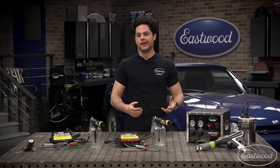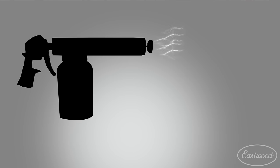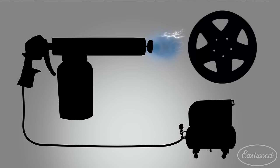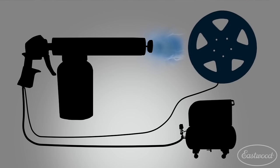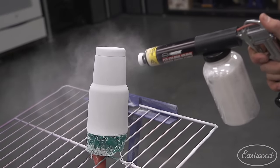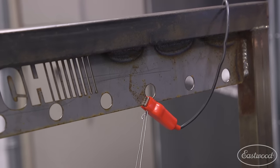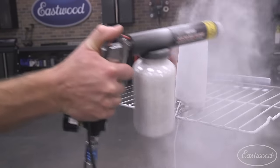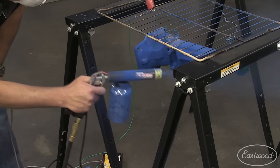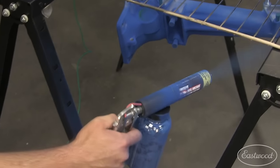So what's actually happening? When you activate the powder coating gun, the emitter ionizes a small patch of air in front of the gun. When you pull the trigger, compressed air flows through the gun, picks up small particles of powder, and blows them out the front. As the particles pass through the ionized cloud — about the size of a golf ball — they pick up a negative charge of up to 25,000 volts negative in our dual voltage system. This is called corona charging. Those ionized particles search for an earth ground or neutral potential — which happens to be your part. The grounding clip connects to the earth ground of your building's electrical wiring, providing the neutral zero potential needed to pull in the powder. Spray away, making sure you get complete coverage. The clear powder bottle on the 150 and 250 lets you see how well the powder is fluidizing and how much you have left.